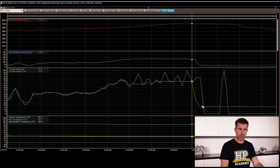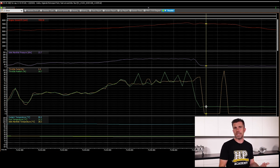The green trace falls down to 16%, which is the default value — basically where it goes when the half-bridge output that drives the throttle servo is disabled. You can see straight away in response I've gone to full throttle, but nothing's happening, so that's the end of the session and I came off the track. So now that we know what actually happened and why the ECU went into fault, probably the bigger question is why has it happened? And this actually turned out to be reasonably quick to fault-find and diagnose.